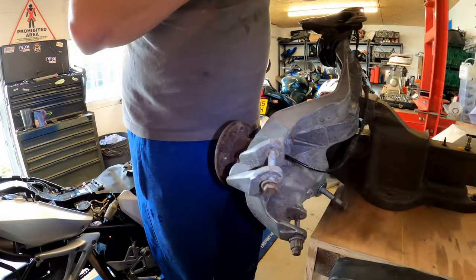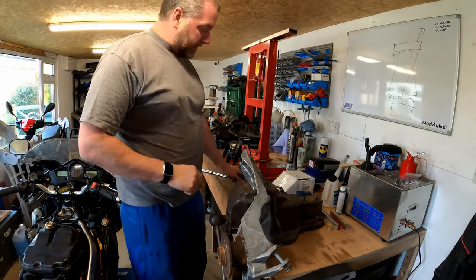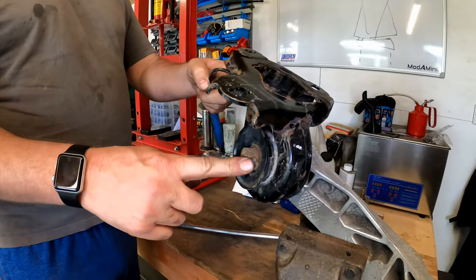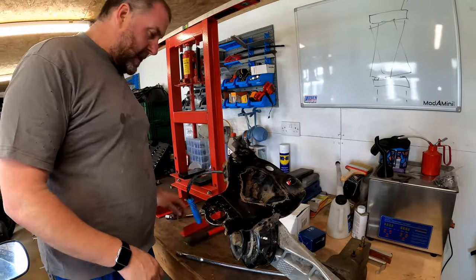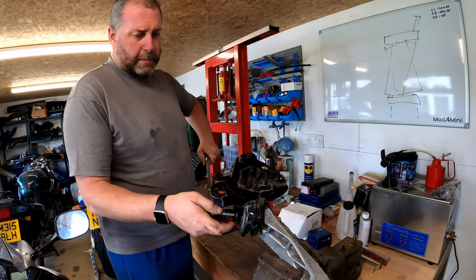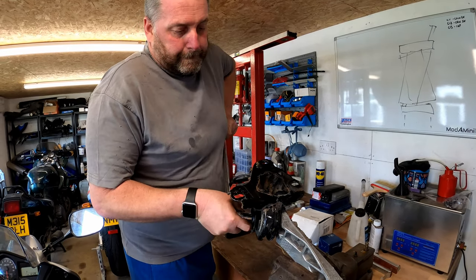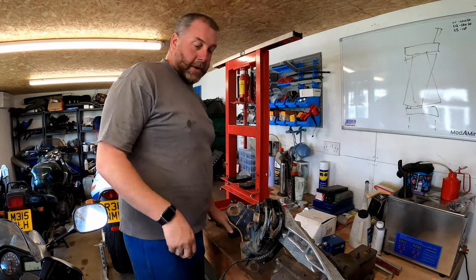Okay, I'll come back in a minute with a ratchet and get the rest, get those bolts out. So now at the front, what we need to do is remove this bolt here. Basically that bolt goes straight through the bush into the arm. So I need to pull that bolt out. Now that sucker is a 20 mil, and this is going to be pretty tight as well. Make sure it doesn't come out of the vise, obviously. And there we are, we've got that loose.